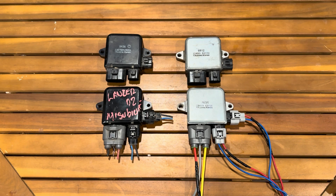There is a version of the controller that comes in a black case and a version that comes in a silver case. The two silver case versions here have two different part numbers. The main difference is that there was actually a recall — many manufacturers replaced the black version with the newer silver box version. The black versions tended to fail, either running the fan constantly at full speed or not at all, causing the car to overheat. So if you're at the junkyard, focus on getting the silver versions.